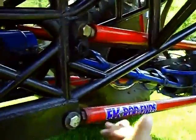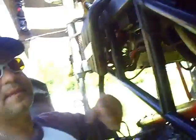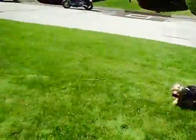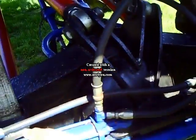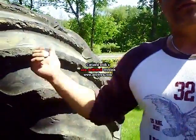The front works just like running in a car. That power steering is in the back — it works the front, so it's kind of like opposite. Turn the wheel, hydraulic, pushes down the lines, the fluid comes right to the front. Same thing over here — goes to the left, goes to the right. That's how the steering on a monster truck operates: toggle switch for the rear steer, regular steering for the front.